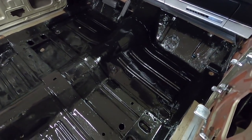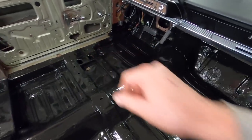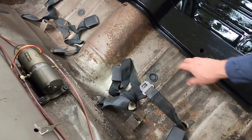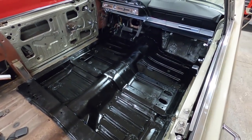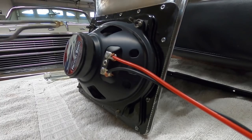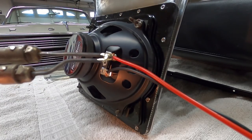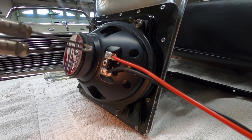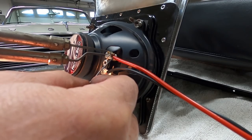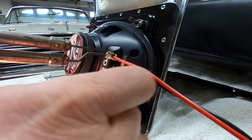I made that metal thing, got new grommets as I said, and I have more grommets so I can replace them too. I pulled the back seat out - I think I'm going to pull the seat belts out and paint from maybe here to this joint. I'll sand that lightly; this is pretty much all dry. I'm going to solder the wires on the speaker right now. The red is to the positive lead - get my soldering gun good and hot, give the tip a little tin to help transfer the heat, put it on there, then feed the solder into the wire and connector so it sucks it in.